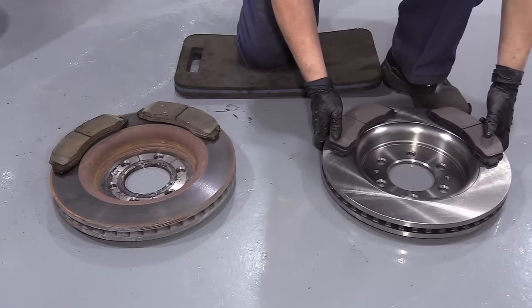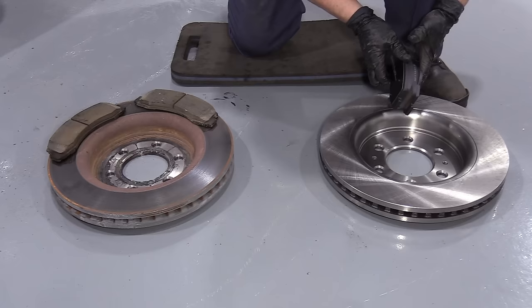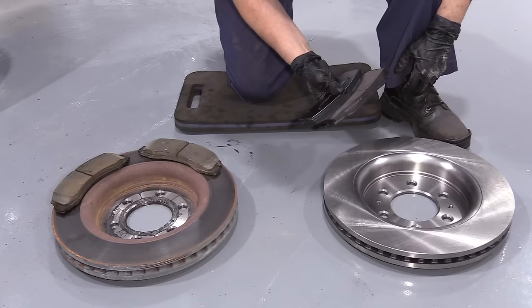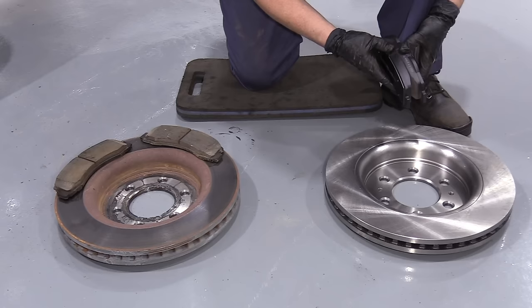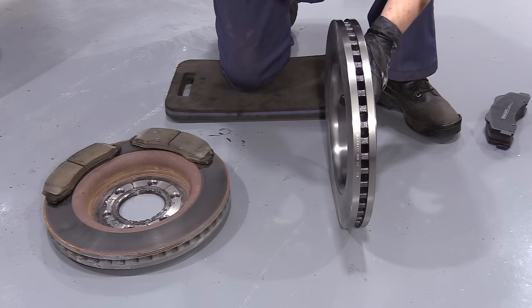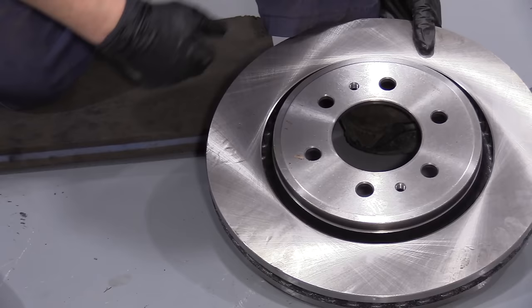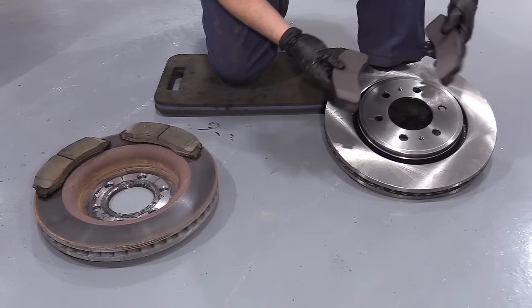Here we have our new set of front brakes for our 2011 Ford F-150 from 1A Auto. The pads are pretty thick and nice in size. There's an inner pad and an outer — the inner has got the half moons on it and milled edges, which help with heating, breaking down of the material, and disbursement of brake dust. It comes with a cut in the middle for heat and indication of wear. The rotor is really heavy duty with major thickness and well-spaced venting, just like an OE rotor. It also comes with threaded bolt holes, so if the rotor gets stuck to the hub, you can apply a bolt to pry it off without hammering. If you need these parts or any other parts for your car, click on the link below and head on over to 1AAuto.com.